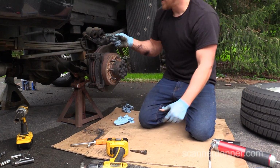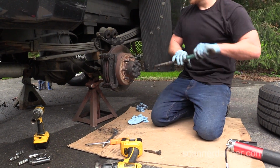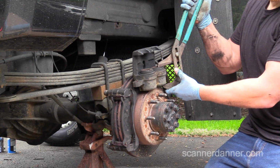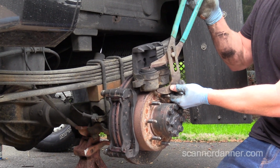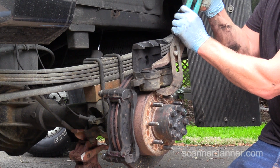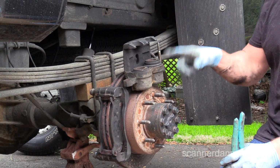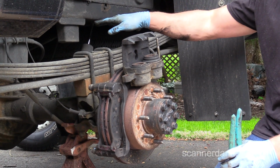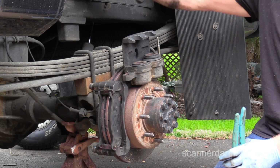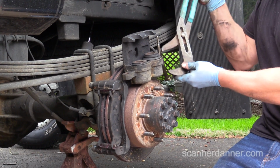All right. Now let's check this piston the same way that we did the other one. This one first. Nice and easy one hand. This one, nice and easy one hand. So what I'll do, let me push these all the way in. And what's happening now hydraulically is I may actually be pushing those pistons on the other side out a little bit too as I'm pushing this one in, although on a split diagonal it may not, because this would be left rear, right front hydraulically.